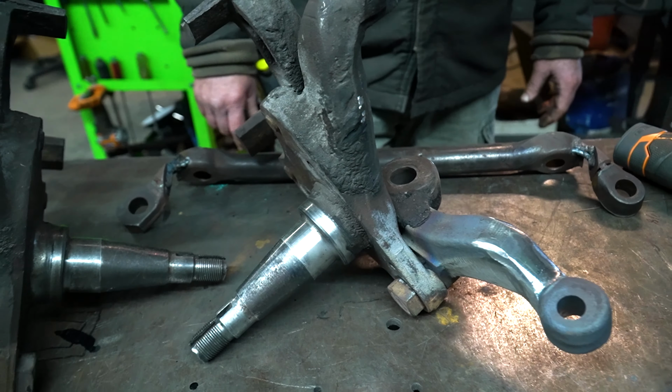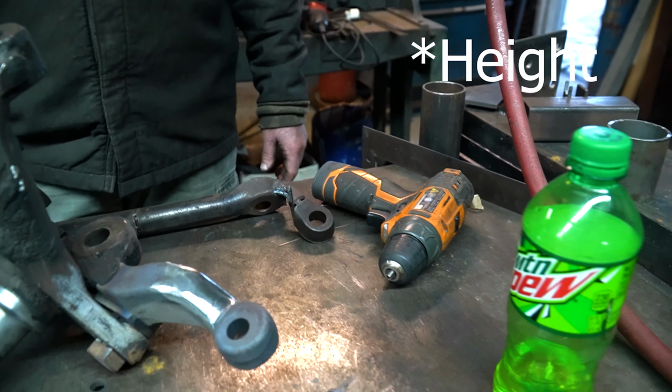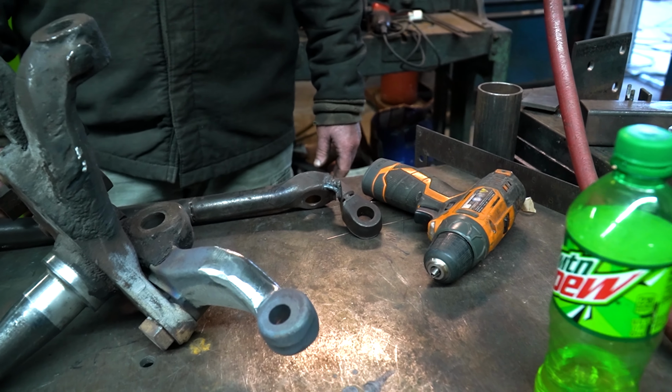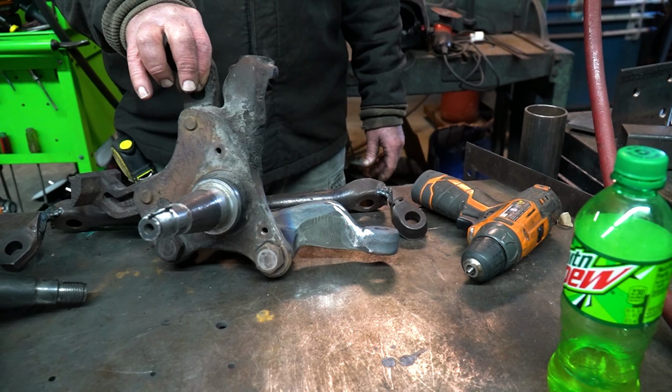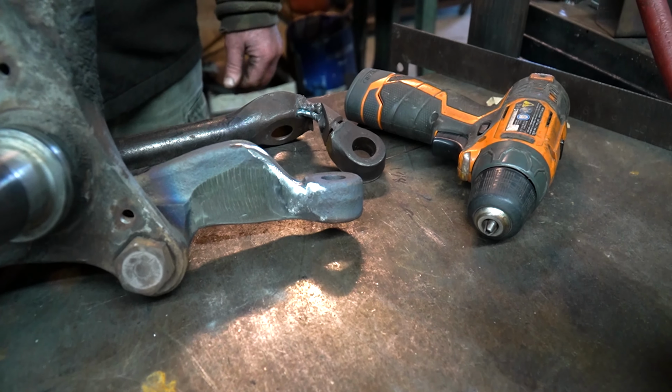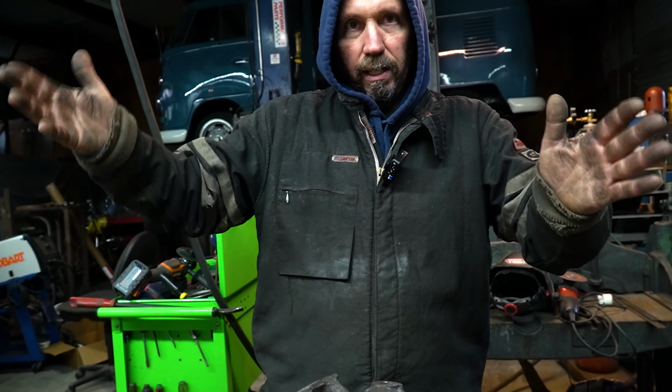Right, and we were just talking off camera that even adjusting the tie rod length up and down, maybe an eighth of an inch, can make a huge difference in the sweep or the arc of the suspension. Yeah, right. And you could adjust that out with a simple little shim, basically a washer or two. That's one of the things that took so long, was changing that over and over, moving that eighth of an inch just to see. And then even the length of the tie rod will affect that, because that's how much it arcs, and you want the arc to match the arc of the A-arms, which the only good thing for me is I have equal length A-arms, so my spindle is actually going to stay straight.